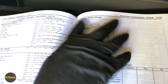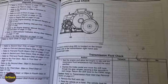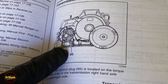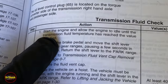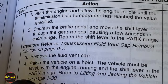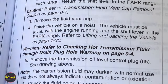Looking at this transmission fluid check procedure in the service manual, this is a 2005 Chevrolet manual specific to the 4T45E. Part 65 is the fill plug — we'll go underneath and see what that looks like in a moment, but it's going to be on the passenger side. The procedure is basically: start up the engine, idle it with the parking brake on, go through the gear ranges to work the fluid through the transmission, remove the fluid cap on top, then get the vehicle up off the ground to reach underneath — but you've got to keep it level.